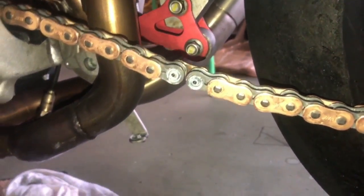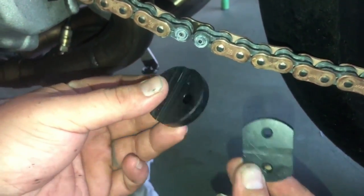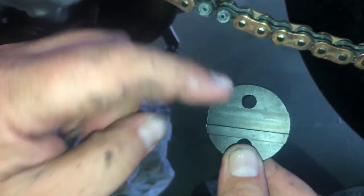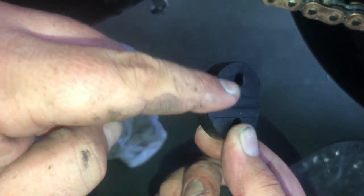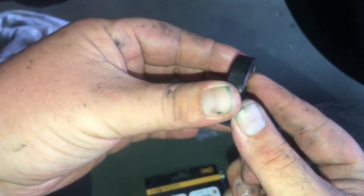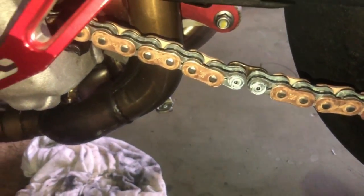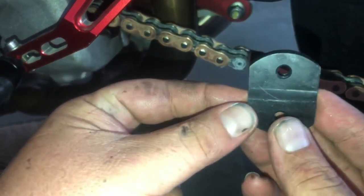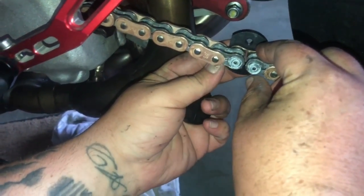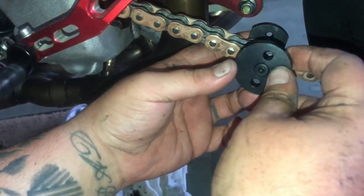All right, so what you're gonna do with the chain breaker tool is you have these two pieces, basically a flatter side and a circular one. The circular one is the front, and this little lineup here, you can see it has like a double step down, is gonna fit over that master link and push it over the rivet pins that are right here. So the back plate, you're gonna have it just where this little line is. You're gonna have it line up with the back rivets like that, and then you're gonna have the front side,